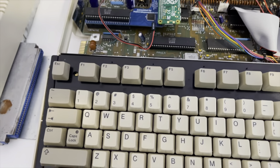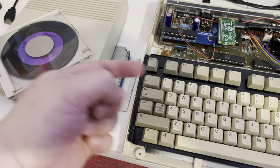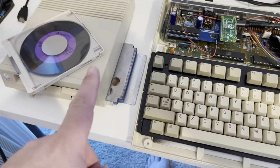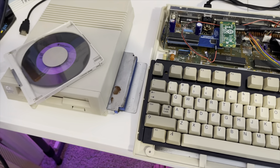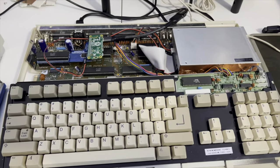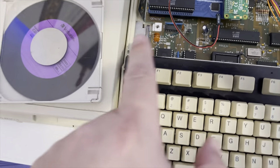So here we are with my Amiga 500, the A570, my disc, and because Commodore designed this thing thinking it was still 1979, the disc has to go into a caddy otherwise it's not going to work. I know you guys hate seeing Amigas naked like this, all the stuff exposed - you want to see it neat and pretty. But with the A570 plugged in, I don't have a way to route my HDMI out for my RGB-to-HDMI, so I need to have the cover off to do that safely. There's the RGB-to-HDMI plugged in. Now I've got to try and jam this into the fast expansion slot and not destroy it. That is in there - she's in there good, slid right in.